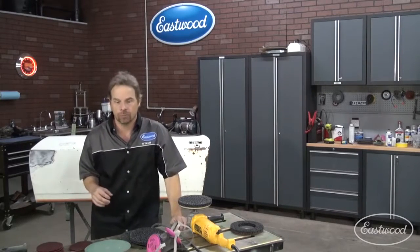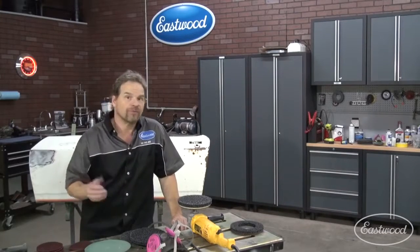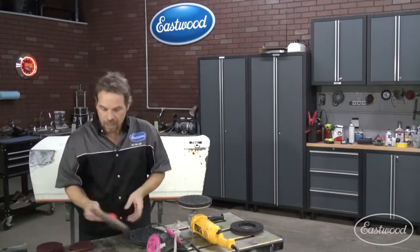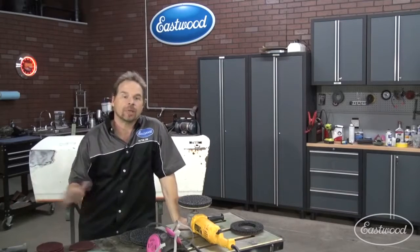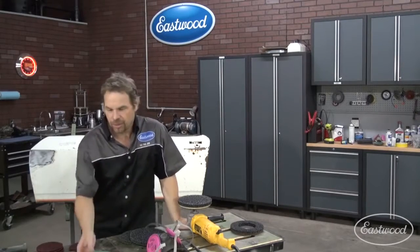I know you've seen these cars going down the road. When I was in collision repair, the fastest method we found — maybe not the best — was to take 36-grit paper on a rotary sander and strip it down to bare metal, build it back up with epoxy, then the top coats, and kick it out the door. It was very effective, but a kind of brutal way to get there.